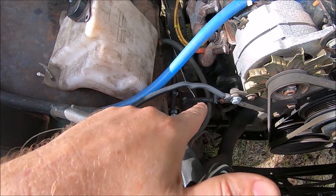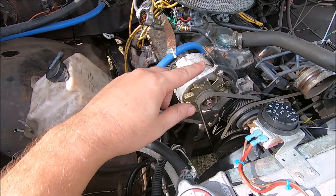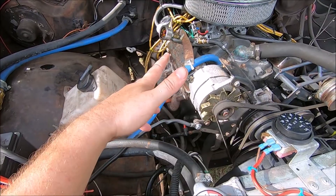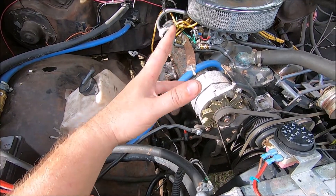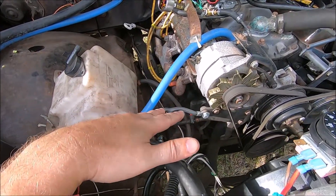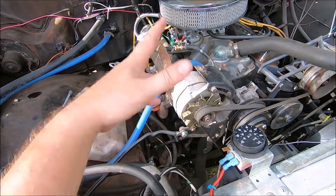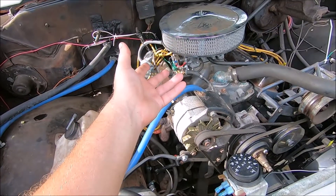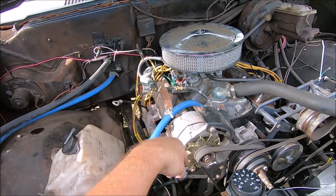The bypass is open all the time. Old mechanical pumps are just a two-line setup — in and out. The return line was added later to prevent vapor lock. It also has a pressure regulator so it doesn't overpressurize. GM was running into issues with vapor lock where fuel would boil in the lines when sitting hot, overpressurizing with no way to escape. You can't start a carbureted engine on vapor — it needs actual liquid fuel to flow through the carburetor passages.